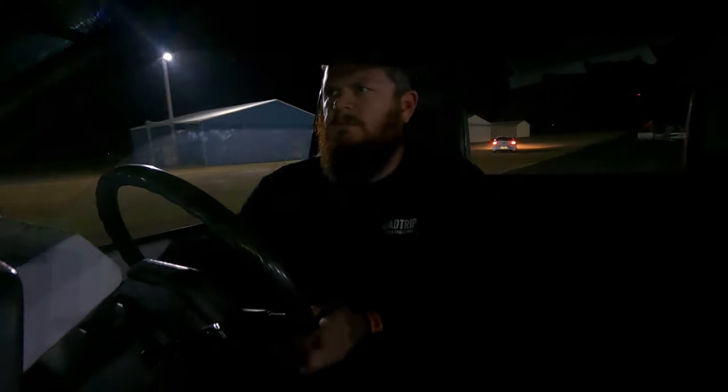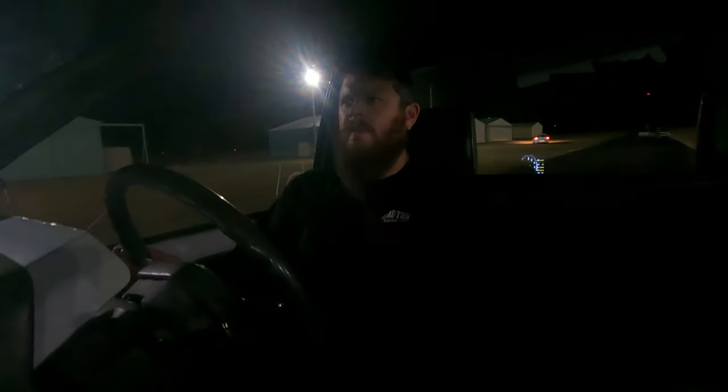Harder. I think we hit a safety though. I lost everything at about 5 grand, 5,500, something like that. We'll get the tuner to check the log on that one. So we sent it out with a much more aggressive boost ramp, but someone forgot to put fuel in it. So we have no idea how successful that would have been. It was definitely better in the 60, but I think there's still a lot more that can be had, so we're going to turn it up harder and put some fuel in it and send it again.